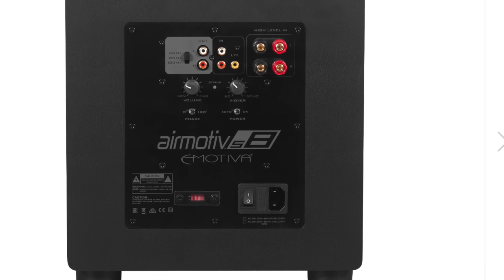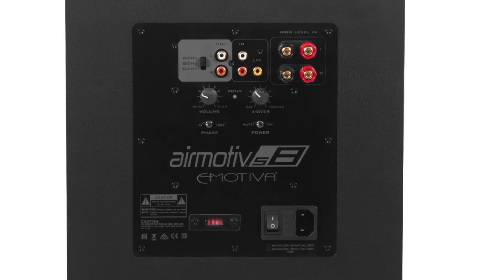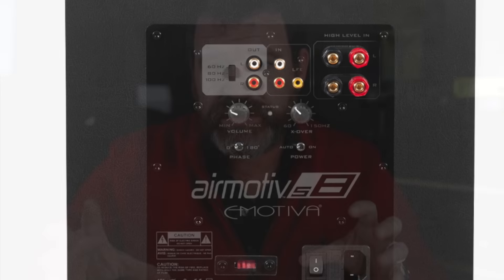So let's talk about how to dial in a subwoofer. There are oftentimes three different controls on the back of a subwoofer: the volume or gain (they can be used interchangeably), the low pass filter which tells the subwoofer which frequencies to reproduce, and phase. I always think a good rule of thumb is to start at 80 hertz. A lot of times those dials go between 40 or 60 all the way up to 250 hertz — I would start at 80. Then put the gain or the volume level at 50 percent. Get it all hooked up and start playing music through it — probably music rather than a movie, because then you're going to get a constant set of bass frequencies. Do something you're familiar with that has a repeating bass line so you can continue to hear the bass notes.